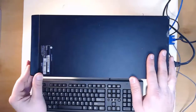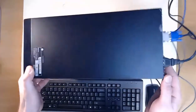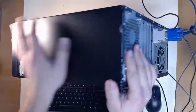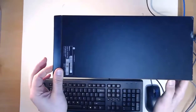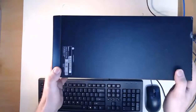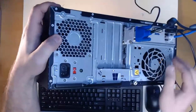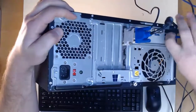To begin, I'm going to power off the computer. Then I'm going to disconnect the power cable from the power supply. We like to depress the power button and hold it down for a little bit longer — that'll get rid of any excess power on the system. On the back of the computer, we can now remove all the video and audio cables, mice and keyboard. I'll also unplug my network cable as well.